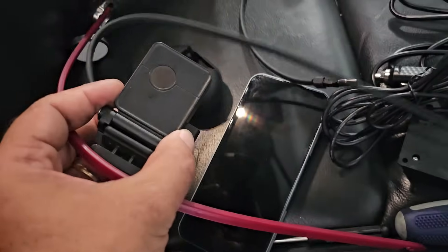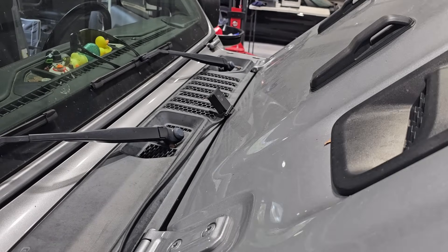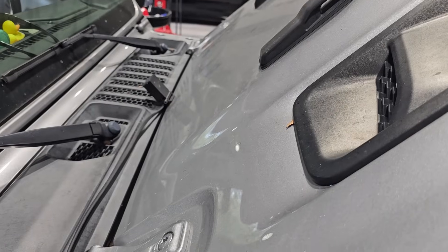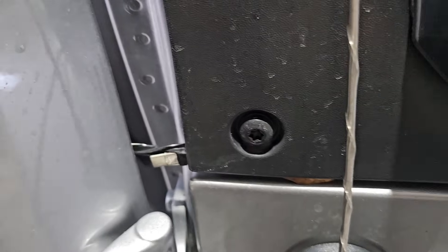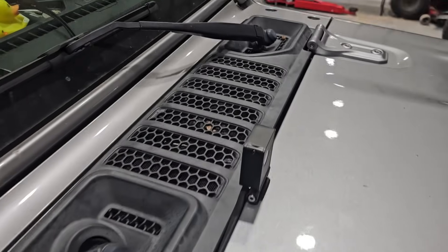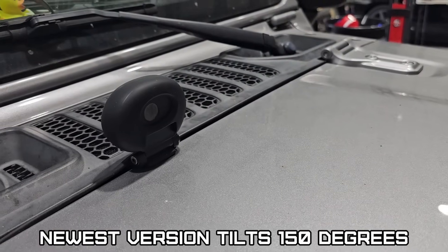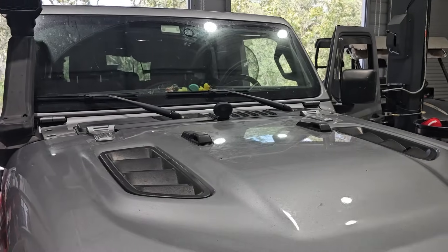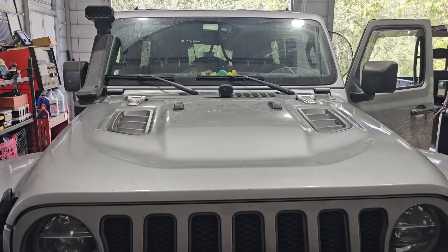It also comes with a cool little pull rod. The mounting area on a Jeep is pretty high, so after the initial installation I think I'm going to end up mounting the camera up front. If you're doing a Wrangler installation, just beware you cannot flip it all the way up — it'll snap the camera. I'll use that fancy pull stick to pull the wire through. Close your lid and make sure the wires don't pinch. No pinching, and you can put your rubber protector on there.